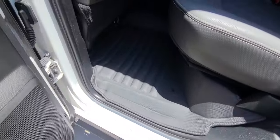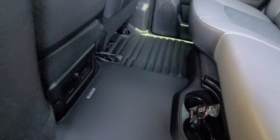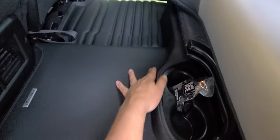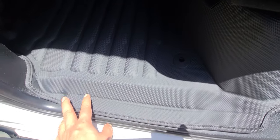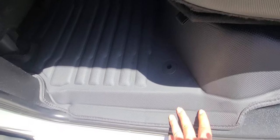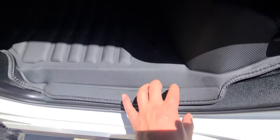The largest one for the 2500 is the back, the rear mat, and it's all one piece — it goes all the way across. All you do is literally just set it in here and then push down on it. It's got a nice curved edge. This thing is really, really well fit. I took and pulled this plastic up and just slid it in — there's a little lip right here. I just took and pulled that back, put it in there, push that back. Now I didn't pull up my side molding because some of them get brittle underneath, so hopefully the kids don't kick it. If they do, I'll pull the side molding up and put it in there. But that thickness may hold these from seating all the way in. That is a clean looking floor mat.